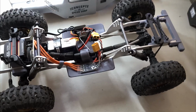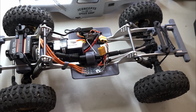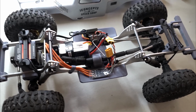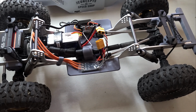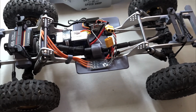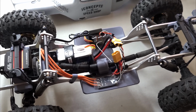All right, guys, so that was just some running footage of the Crawlmaster Mini ESC with a Holmes Hobby V2 snub nose revolver, 1800 kV on 3-cell. So I guess to wrap it up, there's a couple reasons you would get this. One is to quiet down the outrunner motor if that's an issue for you. The other reason is that sine wave startup RPM lock.